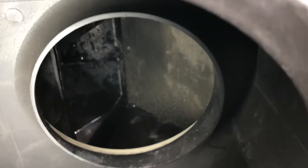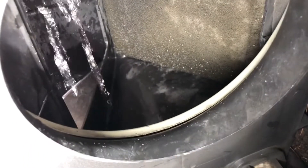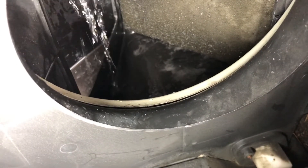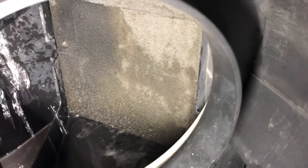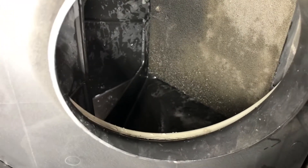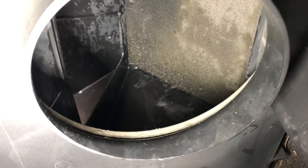Go ahead and turn on the hose. I pulled out the blower so you can see - but if you look in here you can see we get drips every so often into here. What happens is I believe that it is leaking down inside of the firewall there because you can see the paint color. This is the firewall and we have water on the inside of the firewall there - so I think that's our problem. You can see how it's been getting that foam door wet. That piece of foam there is a door that moves back and forth but it seems like the water is coming inside where it's not supposed to. It's set up to handle a little bit but there's quite a bit that comes in there, and I think it's just splashing around in there and the foam seal to the firewall is no longer all that great - I think that's what the problem is.